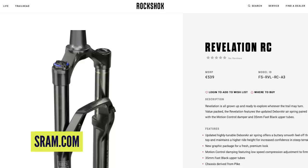Buying cheap stuff on your bike is great — just take care about where you do it. Suspension: rear shocks, there's less of an issue with a cheaper shock. But with a cheaper fork, the damper internals tend not to be that good, regardless of the fork structure. There are great budget brands — Manitou, Suntour, X-Fusion — but with bigger brands like RockShox, you could buy a cheaper Revelation and later upgrade with a better damper from the top of the range, or upgrade the air spring and internal components. This doesn't always work across brands, but on Fox and RockShox you can do it on specific models — worth saving a bit more for the base model of a bigger brand so you can upgrade internals later.